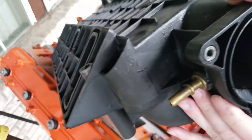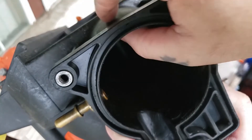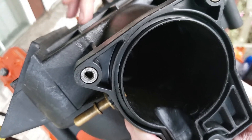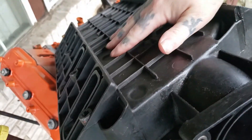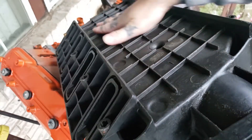Just work on the little notches down here. Don't go past them — you're not going to hurt your intake, it's extremely thick. You just need to knock these ridges down and make it all smooth. A sander works great. A grinder does too, but you can take off too much too fast, so just take your time and smooth it down.